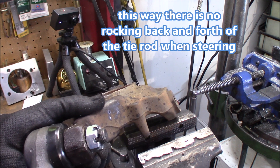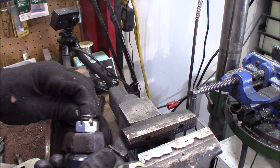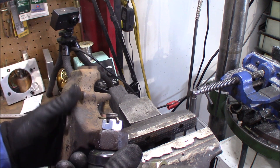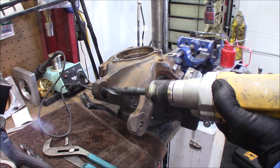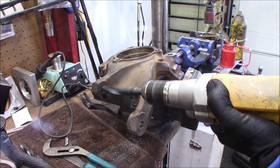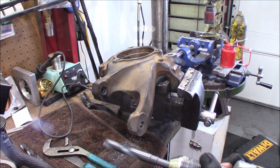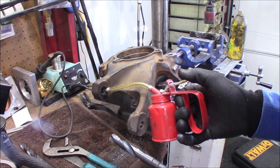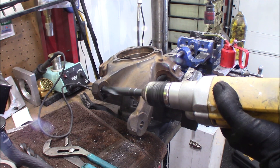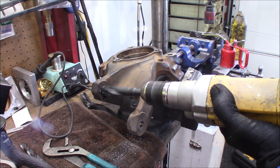You'll see here, this is as far as you definitely want to take it. The cotter pin still secures the nut. Now we're doing the right side knuckle. Starting out with the 5/8-inch drill bit — this really helps reduce the amount of reaming you need to do. The cutting oil really helps reduce the heat on the drill bit and does a better job of cutting.